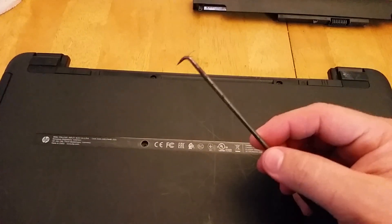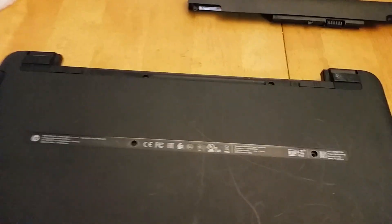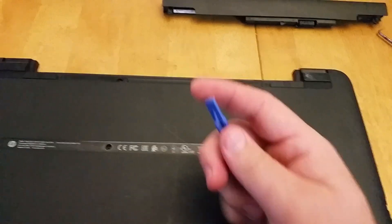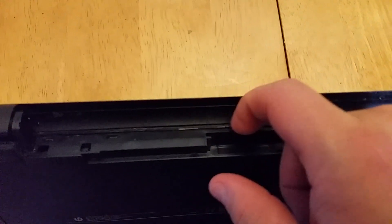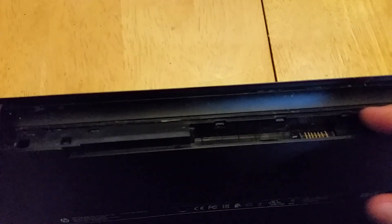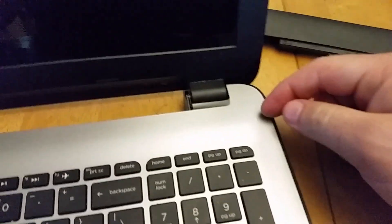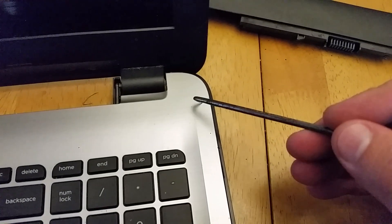The easiest tool to get it apart is an o-ring pick. I tried some of my little handy dandy tools for cell phone stuff but they weren't quite strong enough. The way to get it started is — this thing fits together kind of like Legos all the way around. There are maybe four or five little tabs; you get in the crack and gently pry apart, keep moving down, popping each one at a time. Once you get it loose in the back you can get in with your o-ring pick.